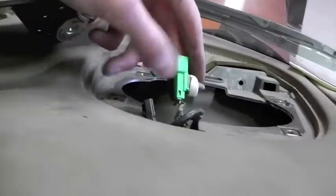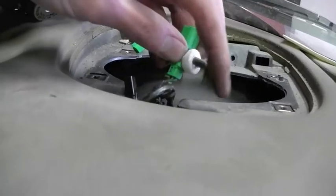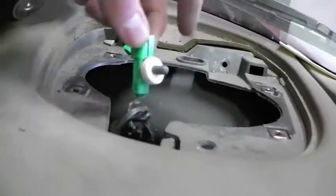Getting this out was not that difficult, except it was by braille. This was pushed in there — if you just pop this out from underneath, it's much easier to undo. Now, because Chevy, we're switching from a 9/32 to a 10mm to remove the knee bolster, which is here to bolster your knees and protect them in a crash. You'll probably need a deep socket for these. Luckily we have enough quarter-inch extensions that this isn't too difficult. Here's the scuzzy, gunk-filled knee bolster.